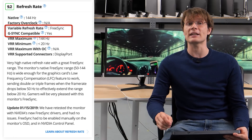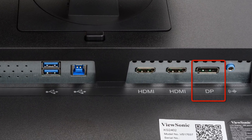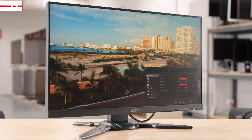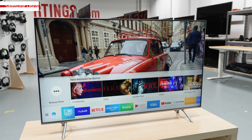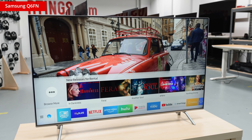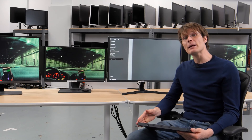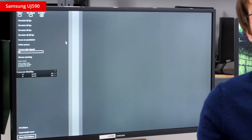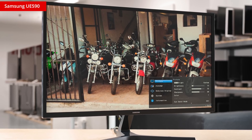There were a few notable exceptions. The current implementation on NVIDIA graphics cards requires a DisplayPort connection, so some FreeSync monitors which only have HDMI, like the Acer XF251Q, aren't supported. This also applies to current Samsung TVs with FreeSync support over HDMI, like the Q6FN, which isn't supported. The Samsung UJ590 monitor experienced constant tearing and artifacts when used with our GTX 1060, which we haven't experienced with our AMD graphics card. The UE590 also experienced strange artifacts.